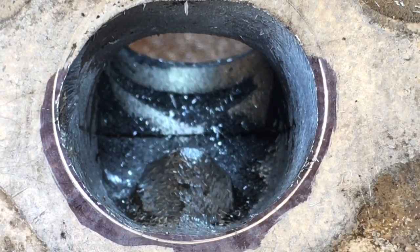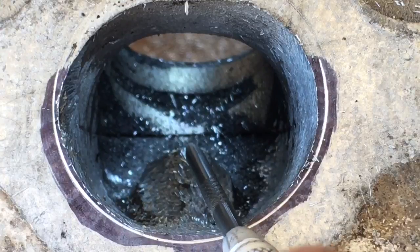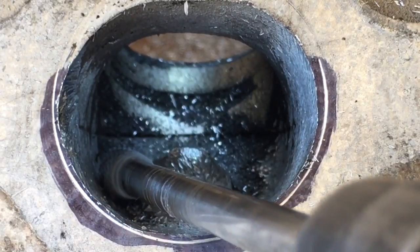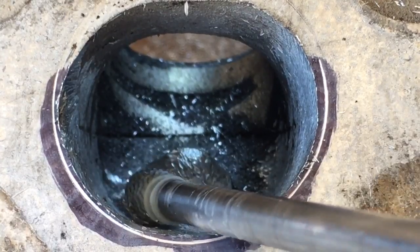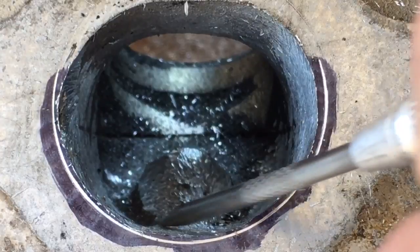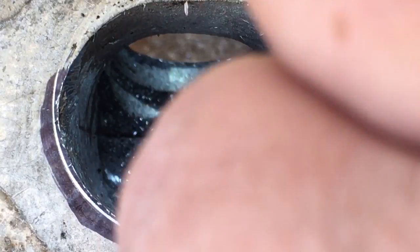With my current limitations, that's not really a good option for me. I wanted you guys to see what I was doing, because when you come from the exit side of the port is the way you want to try to reduce this valve guide boss. I have switched to a double-cut burr. What I'm doing is coming in right beside this thing and pulling into the guide, because I need to widen this area to where all that black carbon and oil and all that junk is removed — you can see it down in those crevices.